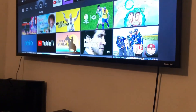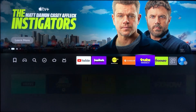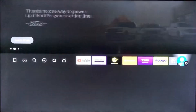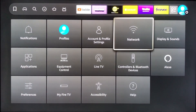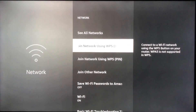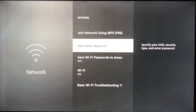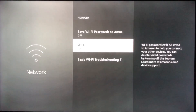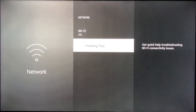Let it sit for a couple minutes, plug it back in, and it should be good to go. Number five on the list: you might have the wrong Wi-Fi password, especially if you're staying as a guest somewhere you don't normally stay. Come over to the Settings menu, scroll over to Network, and double-check to make sure you have the right password — all the capital letters, numbers, and spaces punched in. At the bottom there's also some basic Wi-Fi troubleshooting tips, and Amazon can help walk you through some of that stuff.